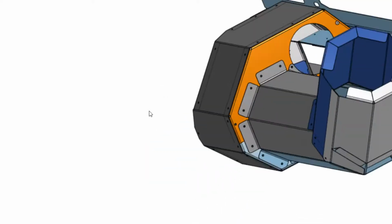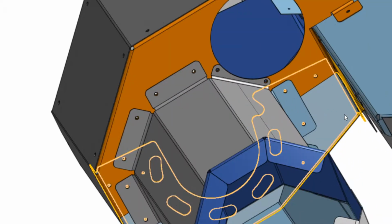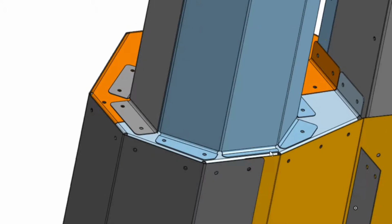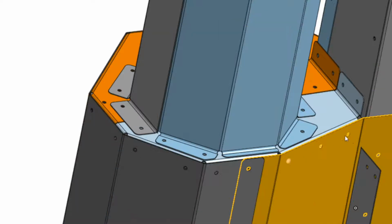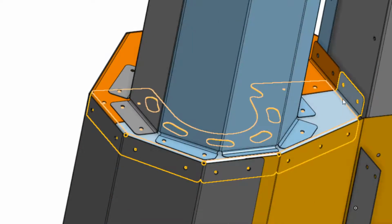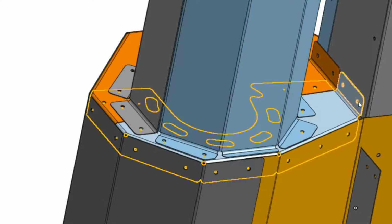You can come onto the right side, and I would probably put on this lower piece first, the one that's highlighted there. It has flanges that bend right to left underneath here, so that there are places for all the screws to go in around there, and it has two screw holes up in the forward part of this forward flange that's bent out in order to butt up against the manifold cover and screw in here and here.